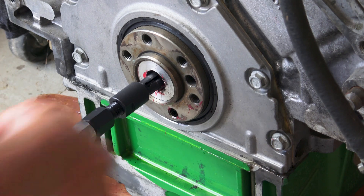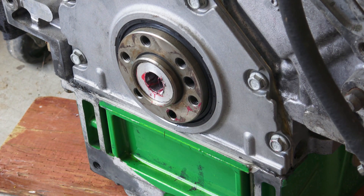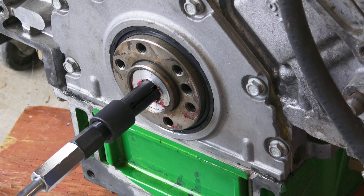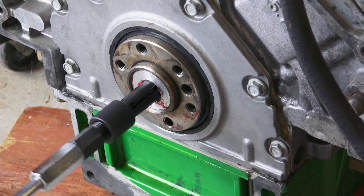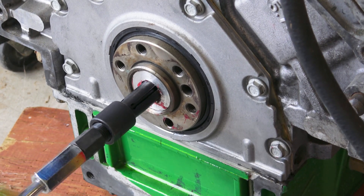At this point I'm getting a little frustrated. Who would have thought an aluminum pilot bearing would be so difficult to get out? Something I didn't show in the video: I did pack the hole full of grease and tried to take a socket about the same diameter as the hole and hit it with a hammer to hydraulically pop that bearing out — that didn't work. So as a last resort, I'm going to drill relief holes around the circumference and hopefully we can get this thing out.